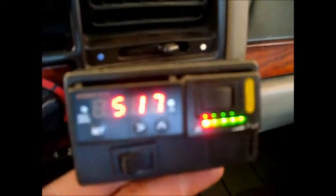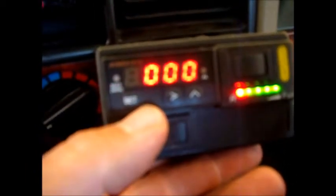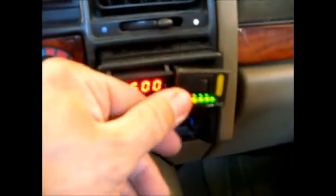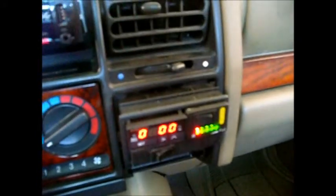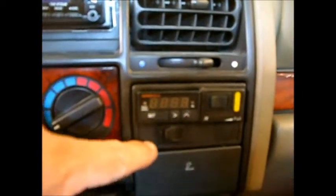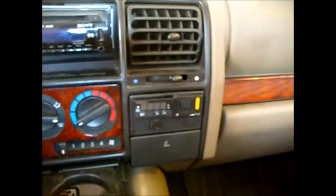I've got a CNG system on it where I can run it on both CNG and diesel — it gives you more horsepower. I've got a video on the conversion on that. But this is the EGT indicator — pretty neat thing. You can set your max temperatures and dial them up as to when it will report your overtemp condition. That's it for the EGT indicator — it's good to have when you have a diesel. Now I've got the modified coin tray back in place. I cut out a plastic piece with a cutout for the switch, for the CNG, and for the EGT. It looks really good — kind of factory actually.